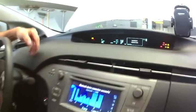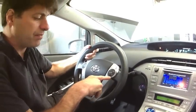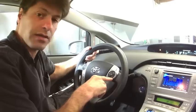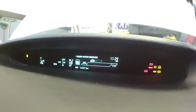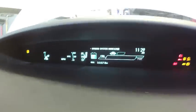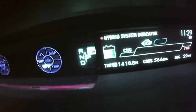Come to your steering wheel and find the trip button. It can be on the right bottom, right top, or left top — in this case it's on the right bottom. Press it until the odometer changes to Trip A.